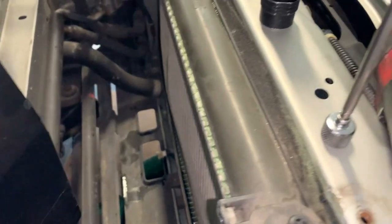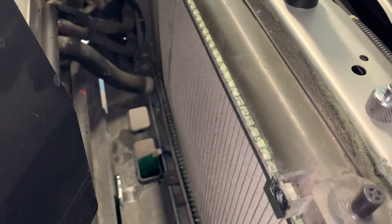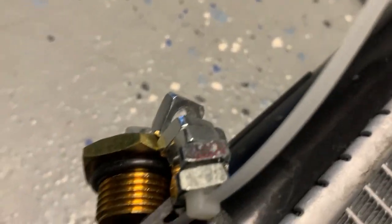That's not good — you see how the radiator looks all impregnated? This car looks like it's been in a wreck before. The AC condenser might be pushed onto this radiator, and when you put the new radiator in, that condenser might be touching — I won't know until I take the radiator off. There you have it: the condenser is bent and it's rubbing onto this radiator. You've got to let them know, check how the AC is working. If it isn't working, we could go in and bend it back. Looks like we might be good — it's not rubbing, pretty close though, but it's not hitting. That's all I care about.